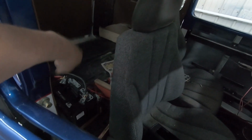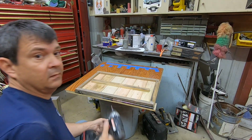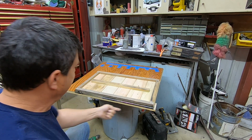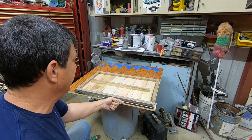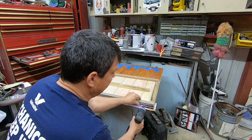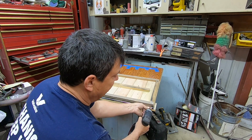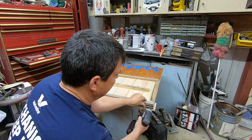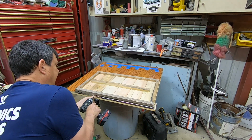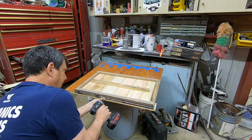You can see back here, there's no wood floor in place back there because we got it over here. Let's check out what we're doing over here. All right, so see what I've done is we got my floor here. I squared everything up, cut this off square. This piece, amazingly enough, I put it together and everything was square and flush, and I didn't have to do any weirdness there. Now I've pre-drilled all these little holes in here with a small drill bit. And now I'm just going back and putting the rest of the screws in it, and I'll flip it down for you when we get a few of these in there. Look at it and see what we got going.